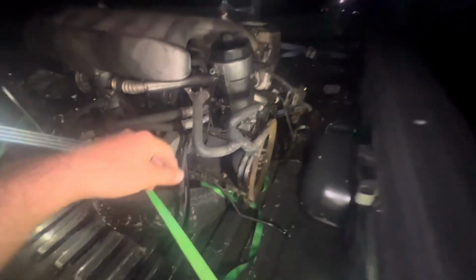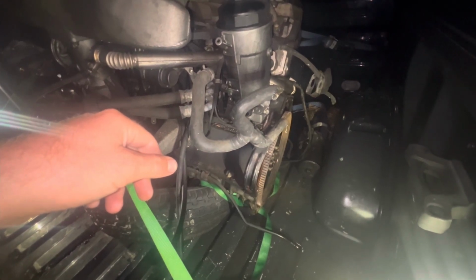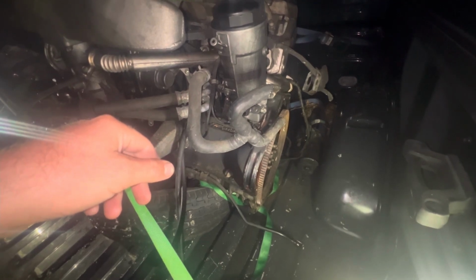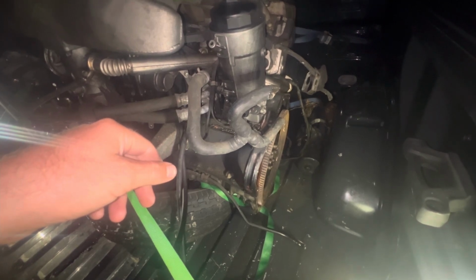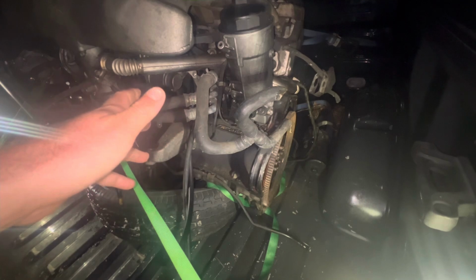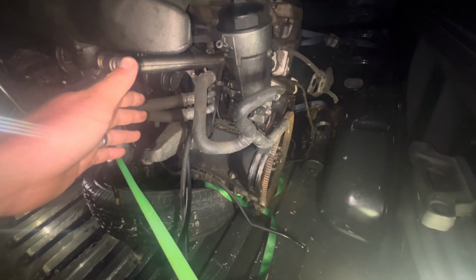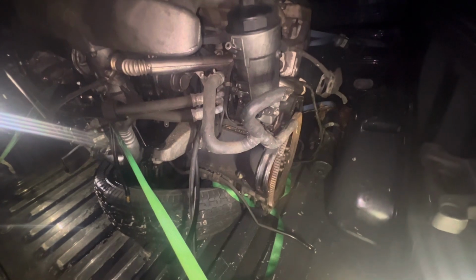For the transmission, still up in the air. I think from my research, we might be going to a Dodge 8HP70, I believe it is. They're rated for a lot of power, very dependable, surprisingly, because they're a Dodge product and I've never heard of a transmission being good from them. But from all my research that I've done today, they're a pretty stout unit, relatively available, fairly cheap, strong right out of the car, even from a junkyard. It should be a ripper.